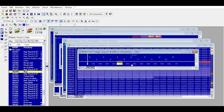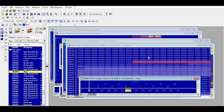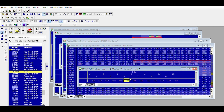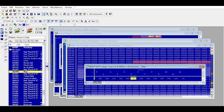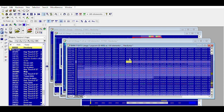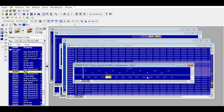This is an automatic car, so it's more dynamic and you don't have to worry too much about clutches. We peak at about 1500 RPM — remember this has an offset of 0.5 — and it's allowing 550 Newton meters of torque. This is a dual-clutch transmission, the DSG box, more than capable of this kind of torque. We hold that all the way to about 10-by-4, which is approximately 5000 RPM. With an automatic gearbox, we know it's not even going to let you go that far unless you're in manual mode.